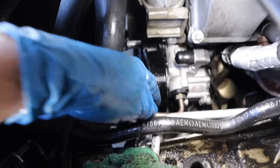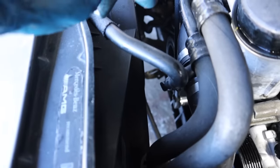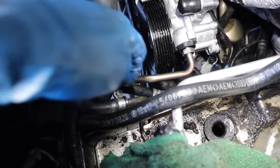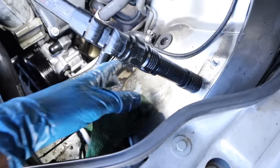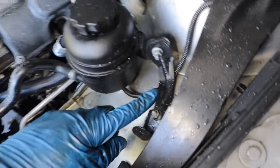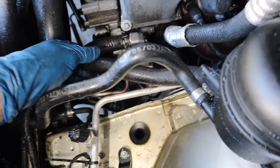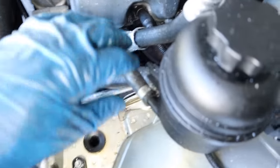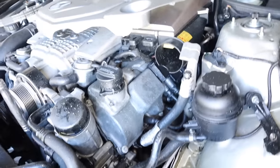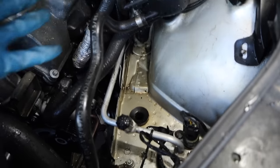The reservoir is in — that's the only part of the bracket you really need and it's pretty sturdy. It's got a little grommet so it can flex when the engine moves. I just pushed the clamp all the way up. The line literally slides right in and it's not that cluttered — you've got all this little area still free. I just like having less clutter and less items — that's what makes it easier to work on. This looks pretty good. We'll add some fluid, get a belt, test it out, and make sure the system doesn't start leaking fluid.